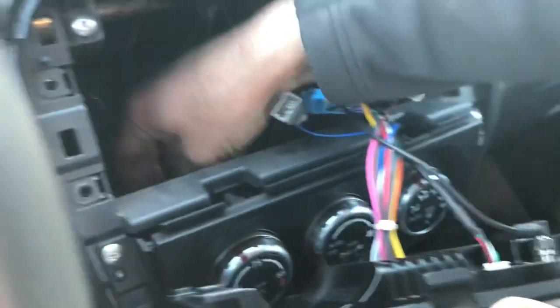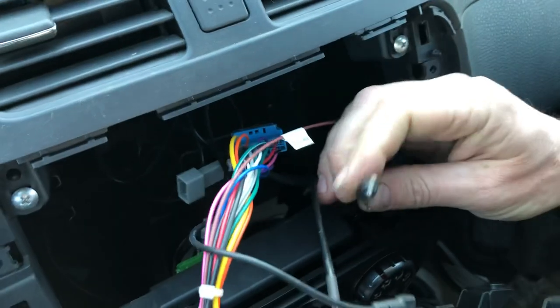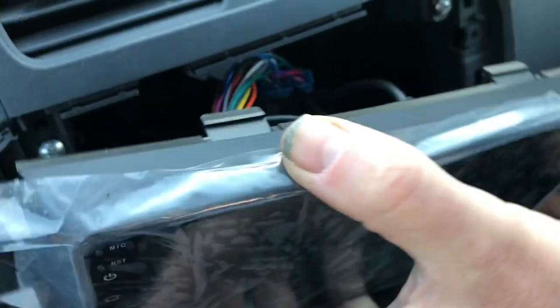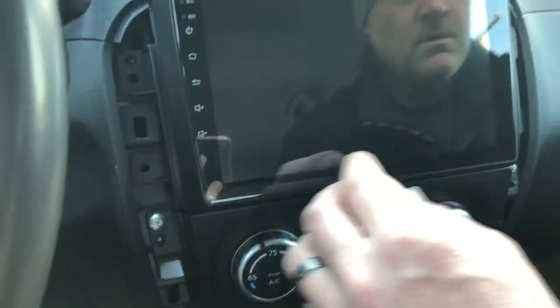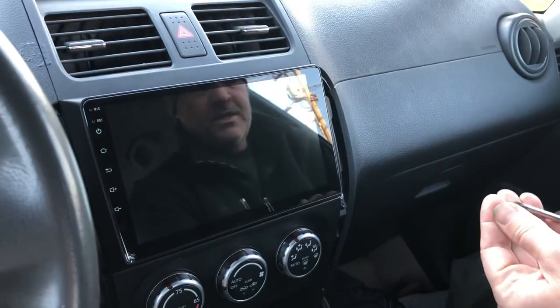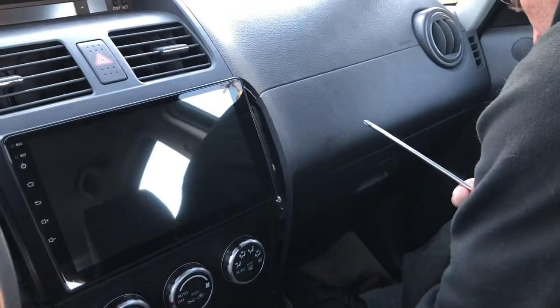And then the last thing is the AM/FM antenna. Plug it in. Try not to wrap wires around. And it plugs in the back. Only spot. One spot. And then this goes in here. There's two alignment dowels there and there. You can also tell because the volume controls are on the left. And this goes here. And then you put your four screws in. And I never tighten anything until all four are in, so you can make sure everything snaps in place.